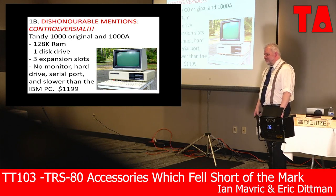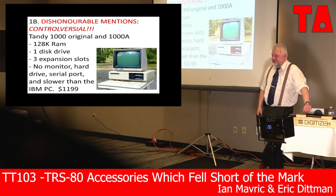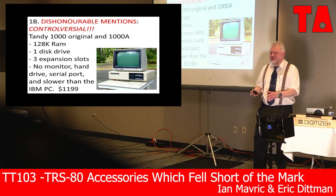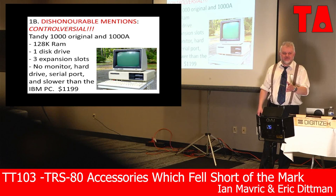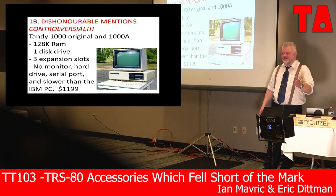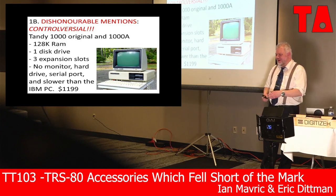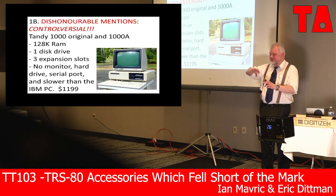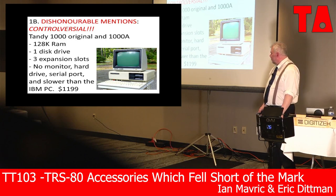It got them into MS-DOS. Yep. I bought a third party card for mine and expanded it to 640K with the clock calendar. Yes, that's correct. So Tandy realized, okay, our first generation memory expansion card, 256K, putting two of them in one of these things makes the customers mad because there's only one slot left for something else. So about a year later, they released a single card which had all 512K on it, so you then had two slots free. And they had a Plus expander that you could put a serial interface onto the memory card, so you then had 640K and two free slots and didn't need an extra serial board. But it was kind of a kludgy setup.